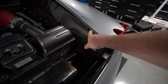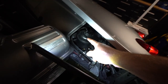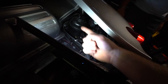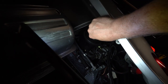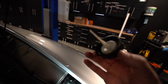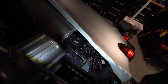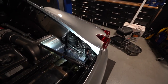We got the panel off. This is the F1 reservoir, the F1 pump is right there, and somewhere up there is the accumulator. We popped off the cap to check the fluid level — and I don't see any on the stick. It's almost totally empty. Well there you go, there's your problem. Looks like we're gonna go get some F1 fluid.